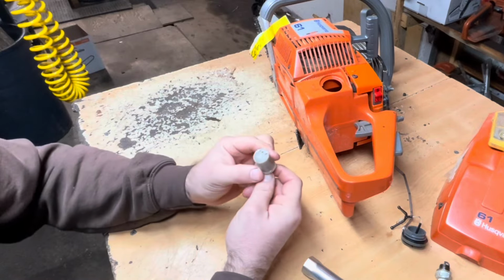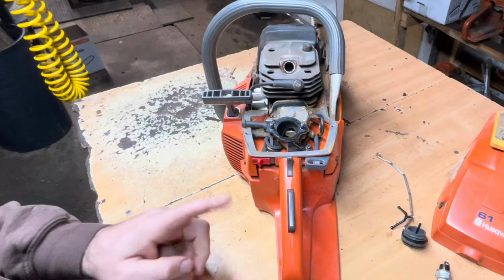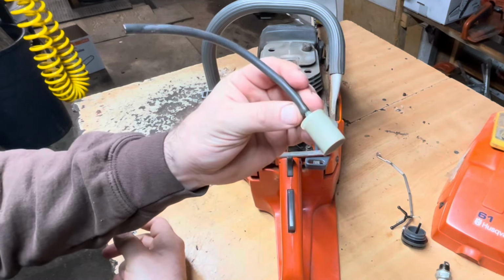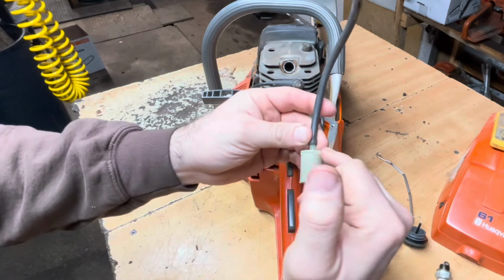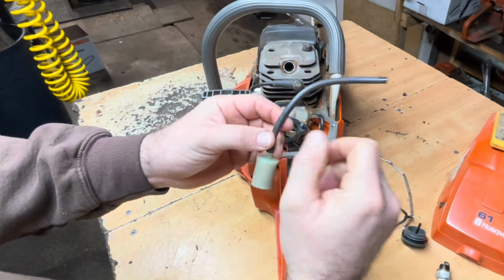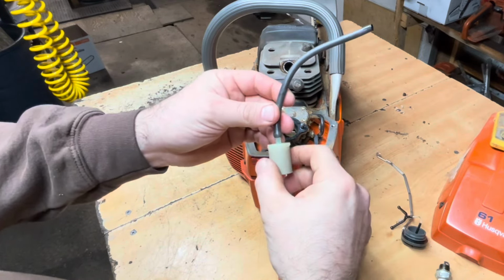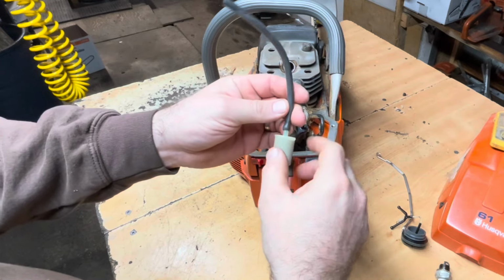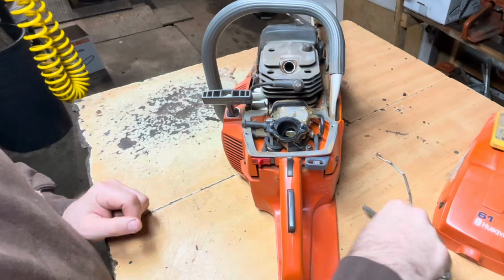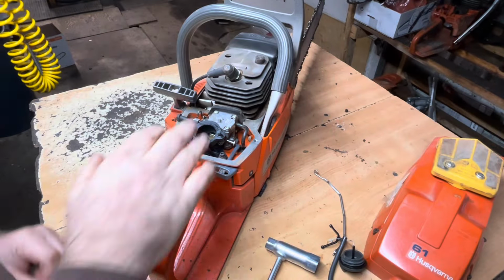Okay, fuel filter's kind of dirty. I'm wondering if that fuel filter's just been on there too long and it's actually pulled fine particles up into the carburetor, into the metering screen, the little, I call it the final fuel filter. It's a screen, we'll get to that. Start pulling this carburetor off. I just got to clean up around it first. Hey, I just got that all cleaned off.